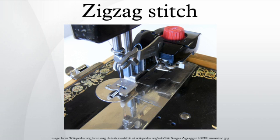YS Star Zigzagger. YS Star is a brand of Japanese sewing accessories that once included a zigzagger, model YS7. Like the Singer zigzagger, it fits almost any low-shank sewing machine and draws mechanical power via an arm connected to the machine's needle clamp. Its stitch pattern is controlled by small flat rectangular metal templates, 7 of which are included. 2 versions were made.